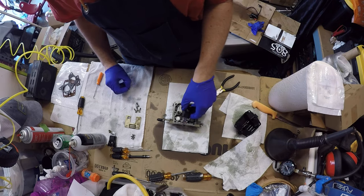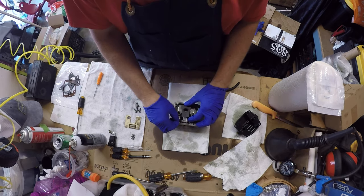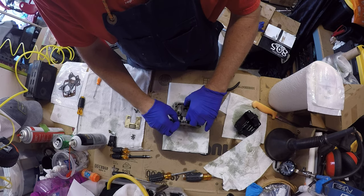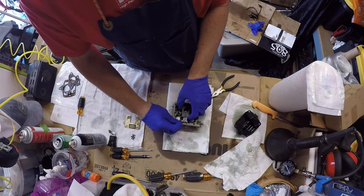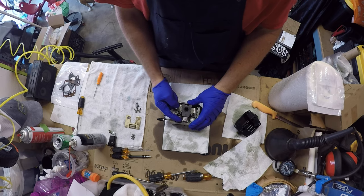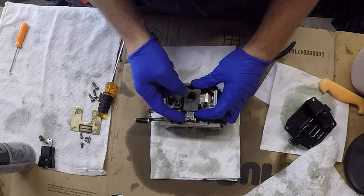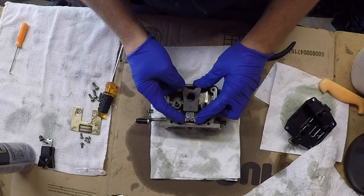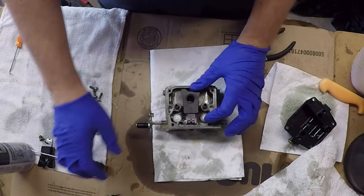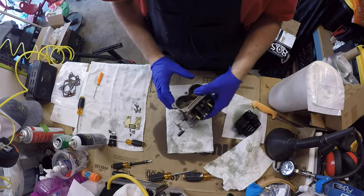That's nice and tight. Next is putting the float back in, making sure that the needle goes in there and this little guy slides right in here, slides straight across. Then you're going to feel it kind of stop — it doesn't really want to go in too much, it doesn't screw, it's just pressure. Once you get that in there you can just move it around and try and find where it goes. You'll feel it kind of click into place. Once you feel it click, you can push on it pretty hard with your finger but it's not going to go in, so I'll just take my screwdriver and push it. That's it. Now that it's set, check and make sure that the float is pretty good and make sure that it works.